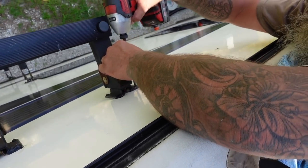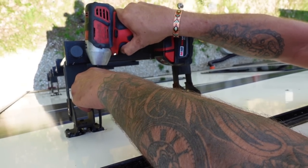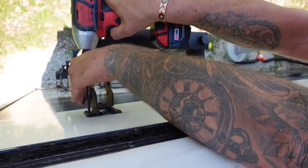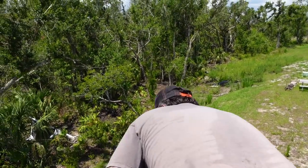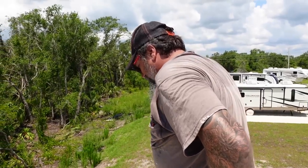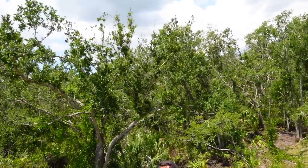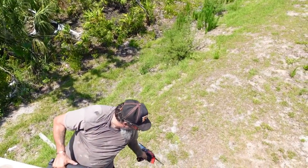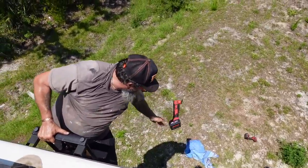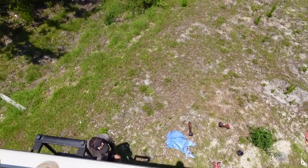They were really loose — actually loosening up. That one was really loose. So that's a reminder: you've got to check all your screws, nuts, and bolts. It's surprising — just a loose screw like that and water running past it somehow funnels right down through those screws. I think I'm ready to get off the roof. Well, at least with this job you don't need to work on your suntan. That's why you buy Milwaukee — testament to Milwaukee tools right there. You get tossed off the charger roughly three or four times a day.